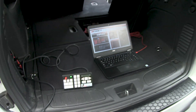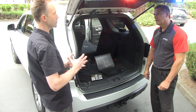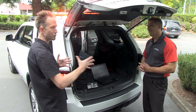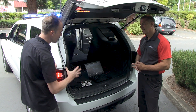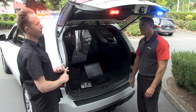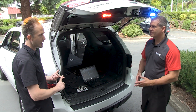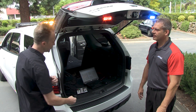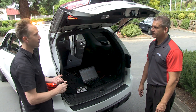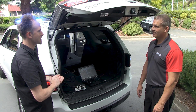I love how you were mentioning that you don't have to use the buttons in a standard configuration. Exactly. The beautiful aspect of the Matrix is we can make the buttons do what we want them to. There's on and off, there's momentary aspects to them, but if we don't want the traffic advisor — the car doesn't have equipment for it — rather than those buttons being lost, they can now carry over into scene lighting like you've gotten programmed in here.